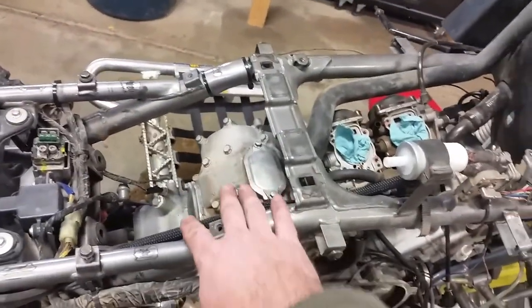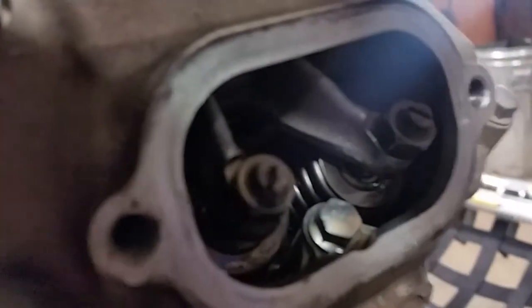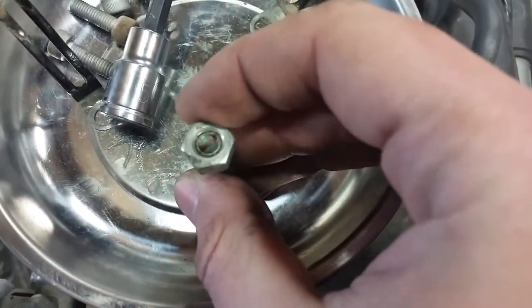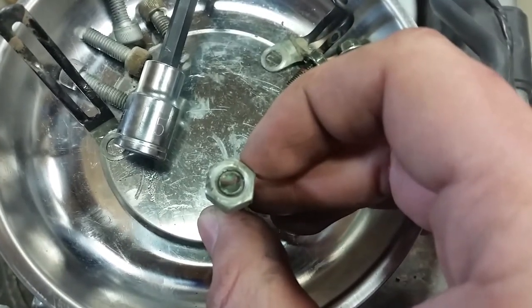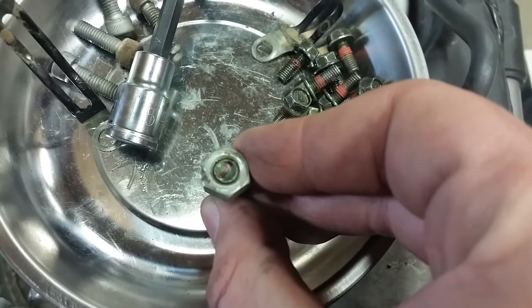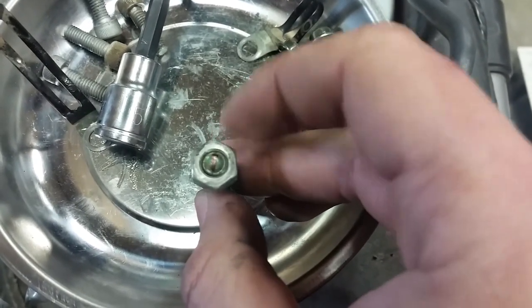For each cylinder you'll do that method. What I'm going to show you here is a rough diagram of a bolt — you can see there's a line on there indicating the flat head screw on the tappet, which I have a cover off so you can see. That's the flat head screw and then the jam nut. You want to loosen your jam nut, take your screwdriver, and tighten it until it's just snug. Then line up the flats or the tips on the nut until they're in line with your screw. You'll want to loosen the tappet a quarter or a sixth of a turn for your intake and roughly a quarter turn for your exhaust, then tighten your jam nut down.